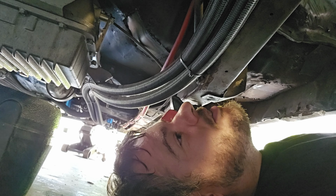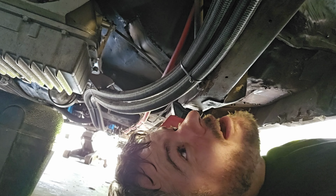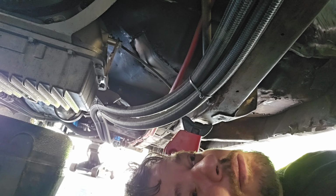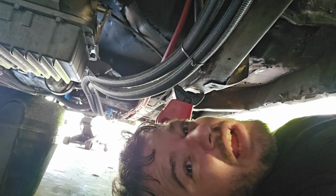And I guess the starter wire, alternator wire, and then we got to take off the oil pan. We got 4 transmission cross member bolts. Then we have bed plate bolts, and then engine bolts or engine plate bolts, and then she's out. So I'm gonna quit yapping and get back to work.